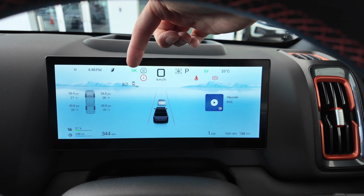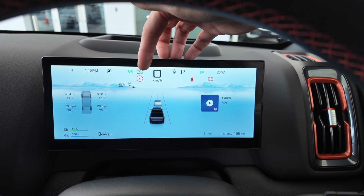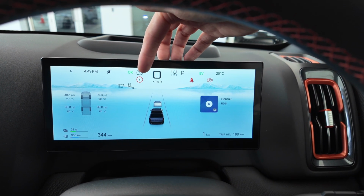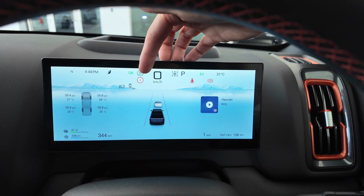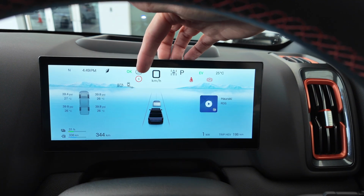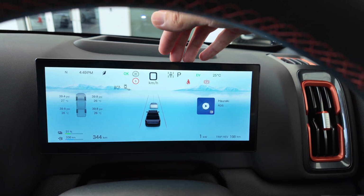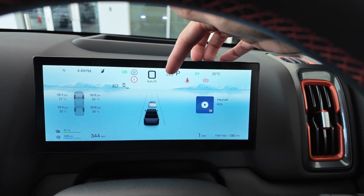OK means the vehicle is on, the vehicle is driving OK. And then the 30 kilometers max and also the 5 kilometers. 30 kilometers max just means when you start setting the cruise control, based on your speed right now, it's going to be set at 30 or any over speed or whatever. 5 kilometers per hour means the speed sign recognition. When you pass by an area that says 60, this will change to 60, 100, this will change to 100. 0 kilometers per hour, this is your on-time driving speed.